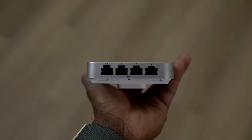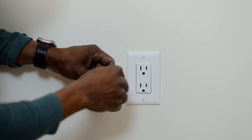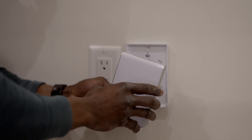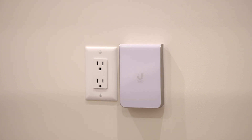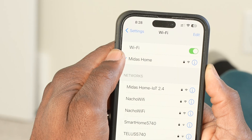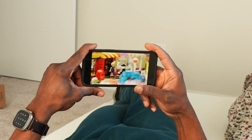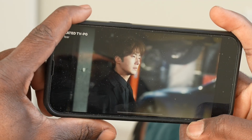They also have 4 Ethernet ports for wired connection, with one providing PoE output. Installation was a breeze — we simply converted an existing wall jack in the middle of the room for use with the in-wall unit. It's powered by PoE, so the UniFi 24-port switch powers it. It supports up to 160MHz channel and 300 devices, although that's a little optimistic for real-world use. Overall, the UniFi in-wall unit proves to be a versatile and reliable solution for home networks, delivering seamless connectivity wherever you need it.